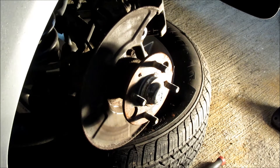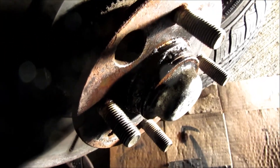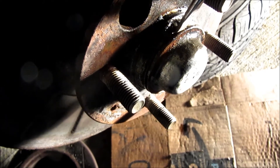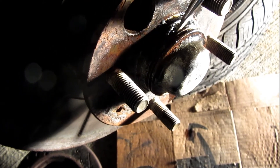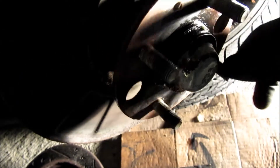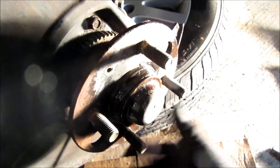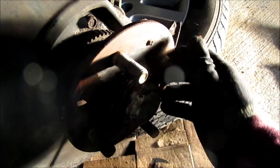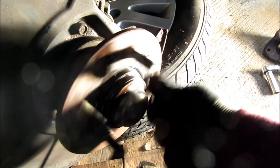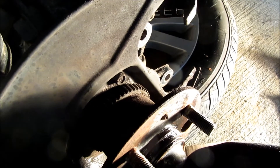Now the next thing I'm going to do is pop off that dust cap for the brake hub nut. Around the edges I'm getting it separated but it's still not wanting to come away, so I just sprayed some penetrating oil in there. We'll let it set for another minute. If you take a listen, you should be able to hear the grinding - and that just gets worse as you're driving. When I'm going at highway speeds it sounds like a plane taking off. Hopefully the race isn't stuck there, but looking at how rusty this is, I'm not holding my breath.